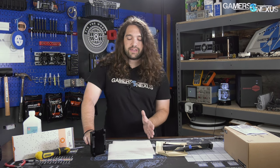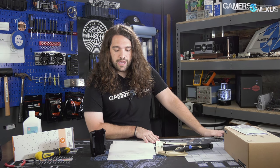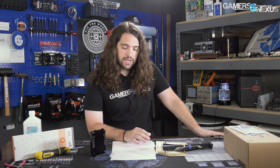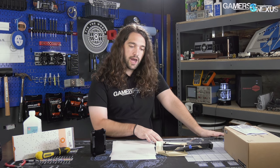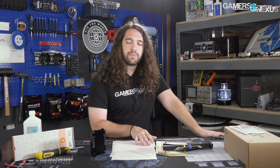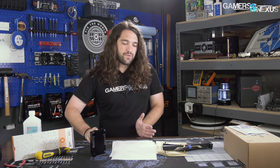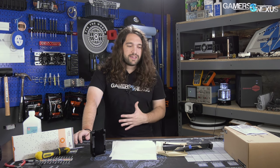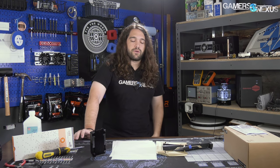On the 8086K, we're not doing a full review. The reason it's worth an overclocking live stream and not a review is because of its binned nature. This CPU does 5 GHz trivially at 1.35 volts. For reference, our first 8700K could barely do 5 GHz — and if it did, it was at like 1.45 volts in lighter load applications. Our later 8700K could do 5 GHz at 1.40 volts, as opposed to 1.35 for the 8086K. The stock operating voltage is also significantly lower on the 8086K. Is it worth the extra money? Probably not — unless you have a really specific use for it and you're definitely going to overclock past 5 GHz. It is not inherently better in any meaningful way in terms of gaming performance than an 8700K.